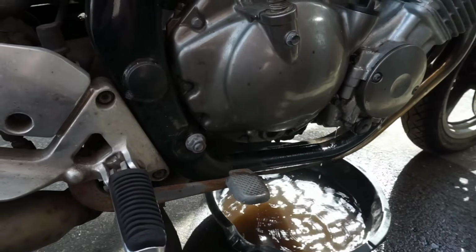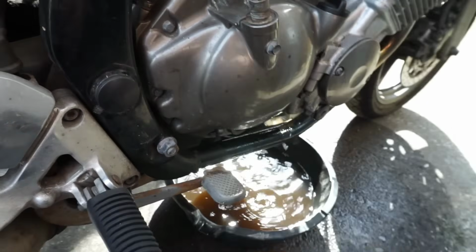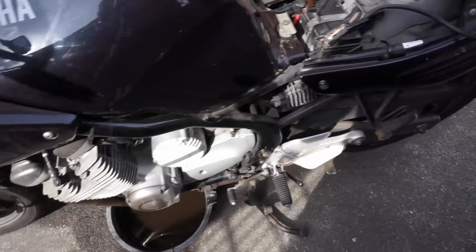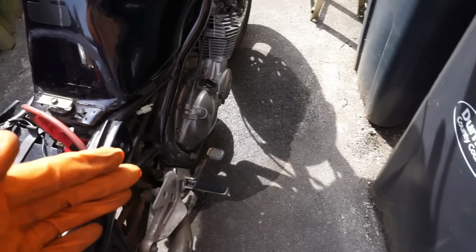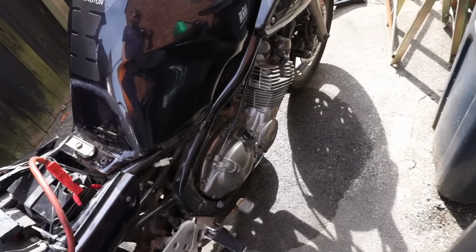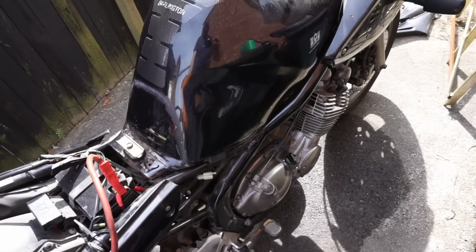Right, I'm going to stop it there because I don't want a fire. Getting a bit of heat. Pull this fuel away. Okay, so I've tried several times letting the fuel run down, connecting the fuel pump up. Every time it just floods that cylinder. It didn't seem to do it when I first got here, so I think there's obviously some debris that's been dragged through from that contaminated fuel. It's probably rust. So I'm going to get the carbs off.